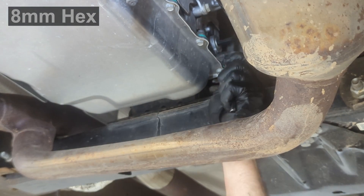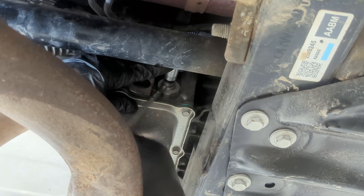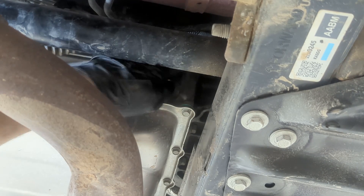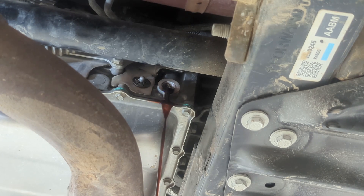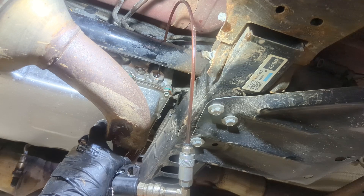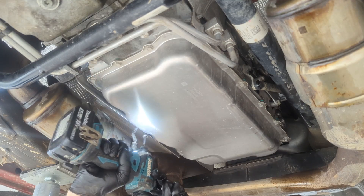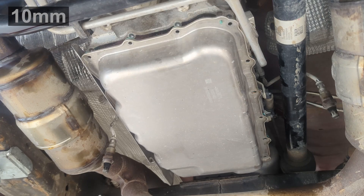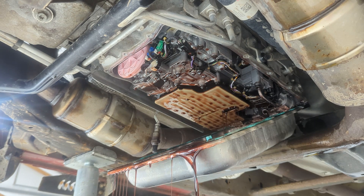Before I do that I'm going to extract a little bit of fluid. I'm taking out the fill plug with an 8-millimeter hex — it's kind of tight going out because it has a little bit of thread locker on it. I ended up putting an 8-millimeter hex bit socket and an 8-millimeter ratcheting end wrench to zing it out quicker. I used a fluid extractor and sucked out as much as I could, but there was still quite a bit left in the pan, and it was difficult to get the suction tube all the way to the bottom.